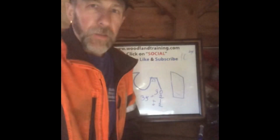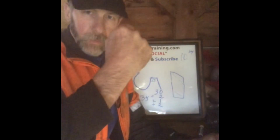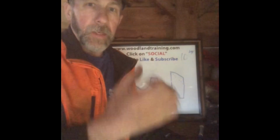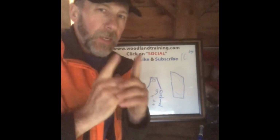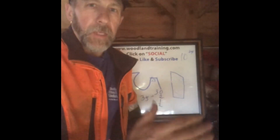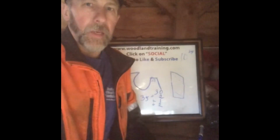So if this reactive force gets out of bounds, we find ourselves either holding on to the saw tight because it's too aggressive, which again tightens up the grip, or if it's not thick enough, the chain isn't sharp, then we're forcing the saw. Same effect on the hand. That's where we start to white knuckle those handlebars because we're trying to force a saw. It's a pretty narrow little window to get into where that saw cuts fast enough. I'm in a race, trying to cut wood, and at the same time keeping that saw so that I can relax with good body mechanics, a little finesse, let the saw do the work, and not death gripping the handlebar all the time.